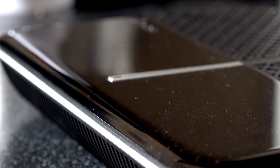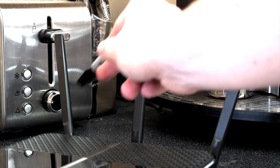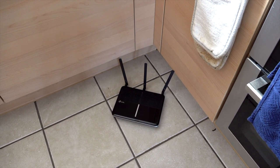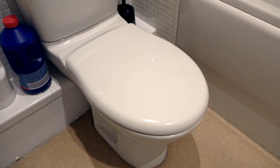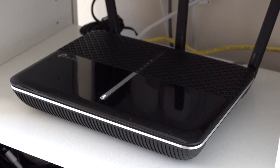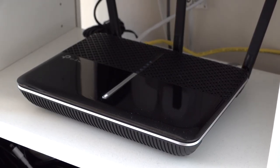Some signal might bounce off the floor, but it's almost always better to put your router somewhere high up — you're paying for those signals, you might as well use them. Your router should also be as central to your home as possible. In an ideal world it would be slap bang in the centre, but practically you've got to have a power cable, the ADSL or coaxial in, and potentially some ethernet. Use your noggin — find somewhere relatively central to your home, but still within a sensible distance of your required ports.